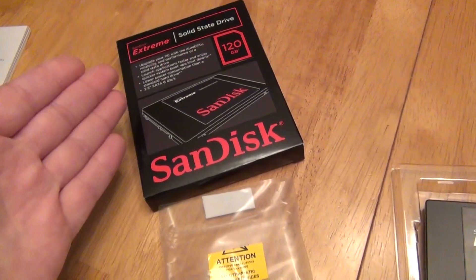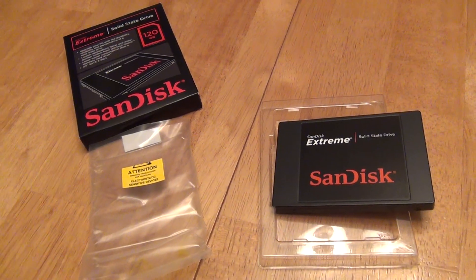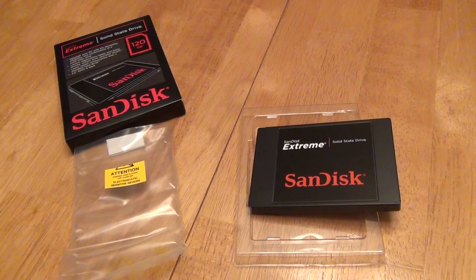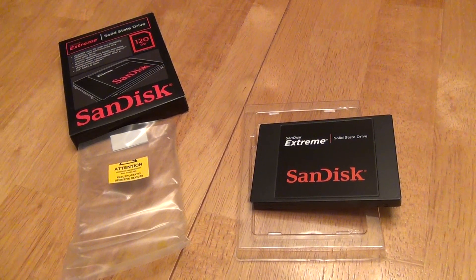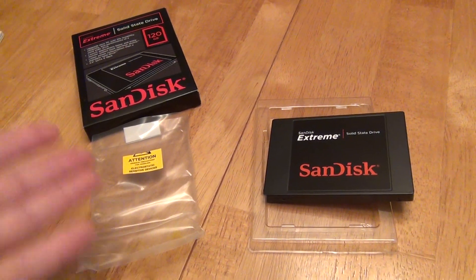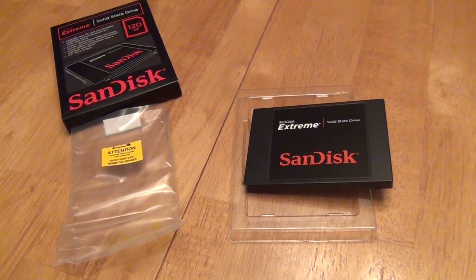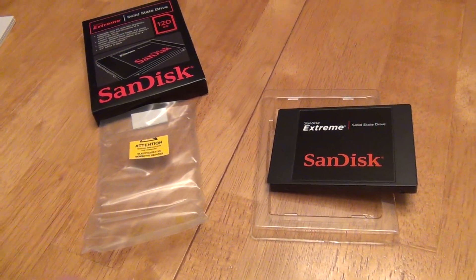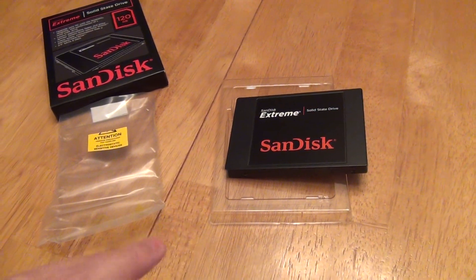Without them giving you actual upgrade software, I was left to my own devices. I'd encourage you to do this first before you buy, just to make sure you know what you're getting into — do a Google search for 'migrate hard drive to SSD.' You'll find a whole bunch of hits, some good ones from SSD Freaks and Lifehacker, giving you completely different ways to do it. You can try to use Windows' own imaging software, but you have to shrink the size of your existing hard disk partition first through defragging, shrink it down, create an image, and then restore it to the new drive using the Windows recovery disk.